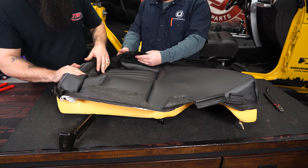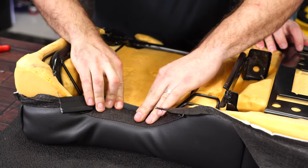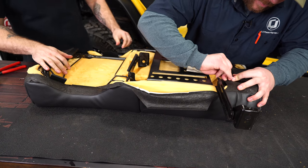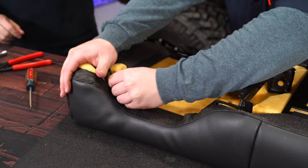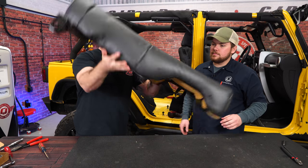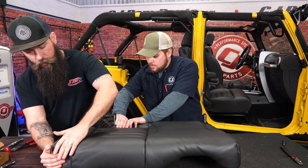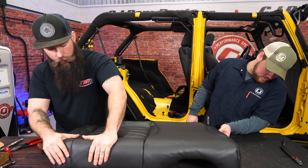With all the hog rings firmly in place you can already see the insert starting to take shape. Now we've just got to put the rest of the upholstery around and clip it around the back. Take these J-hooks and start working your way around, get them all clipped on. Make sure your upholstery is pulled on tight and all the foam is covered — pull tight but not so tight you rip it. It takes a little finessing; if one hook won't go, start at another one and work your way back. With all the clips in place, flip it over and work out the seams — a little bit of massaging will help with the wrinkles.